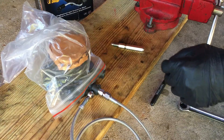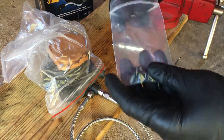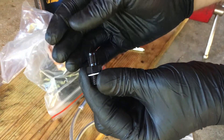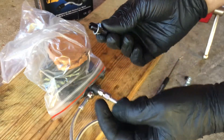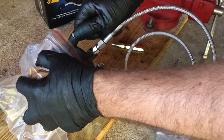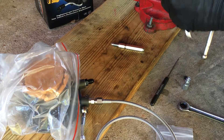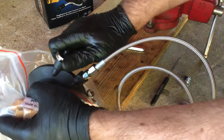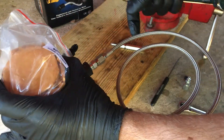That's what we're going to use — from the packet that came with it, you have a tapered insert that will go into the line, and then a washer with a slightly more coarse thread that's going to go on the slave cylinder. Just get it started, get your 13 millimeter on there, and get it snug. You don't need it too tight.